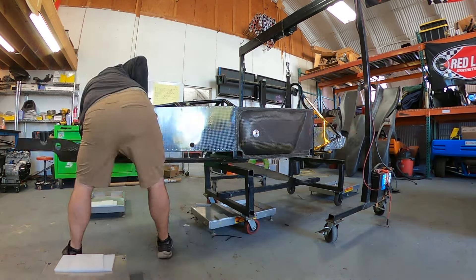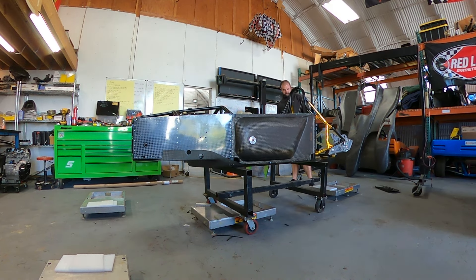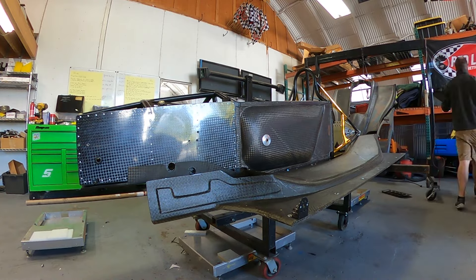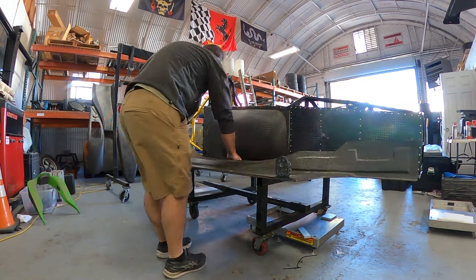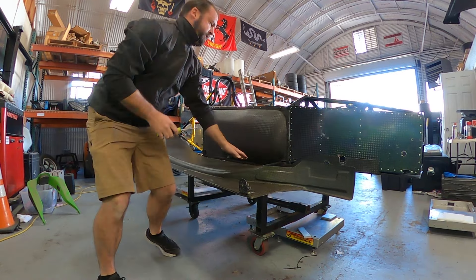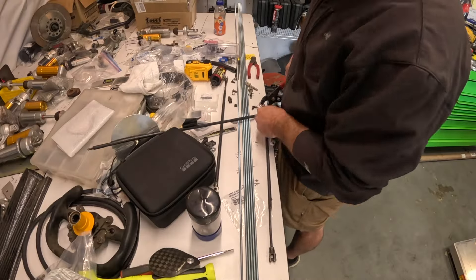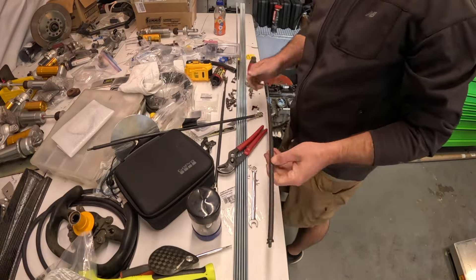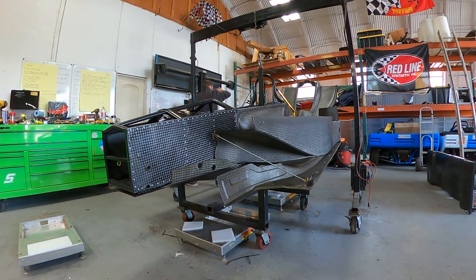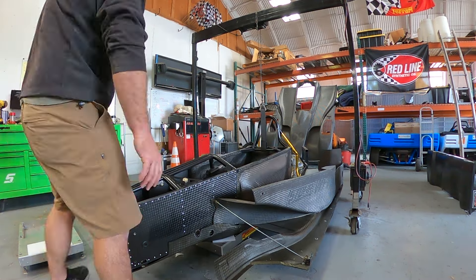I'm not going to put the tail end of my floor on — just the outer tunnel pieces. The rear tail is just going to get in the way of me making sure that I'm on the scale pads correctly, and they don't really add thickness to it. We're actually going to be referencing the bulkhead behind my head, not the very back of the frame where the spar is. There's a taper that goes up on that back box tubing at an upward angle, so it's not a flat piece of geometry. We also had to whip up the stay cables at least for the front — the rear ones we have to wait because we need to make new parts to clear the tunnel at the bulkhead. But the front ones are a pretty straightforward job, so we were able to get those in and make sure the floor is flat across the plane.